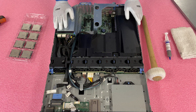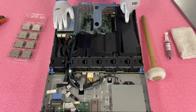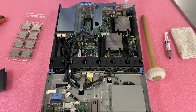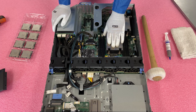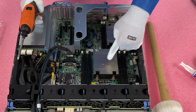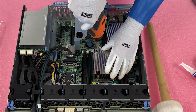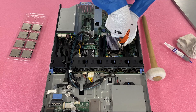Now we're going to pop out the air baffle. On the air baffle it points out CPU 1 and CPU 2, which is helpful — it also says it on the motherboard, but it's under the CPU so it's hard to see. We're going to start with CPU 1. To remove the heat sink, I like to go in a zigzag pattern — kind of like changing a tire — to help relieve overall pressure. Make sure you apply good pressure when unscrewing, but not so hard you strip the screws, because stripped screws are a real pain.